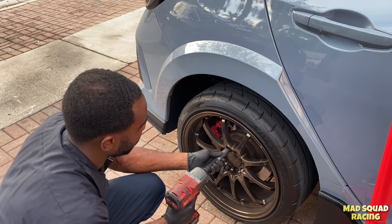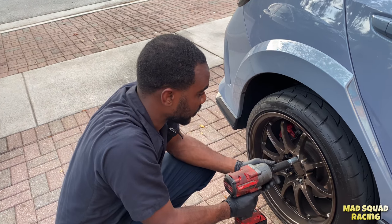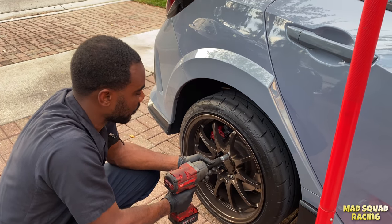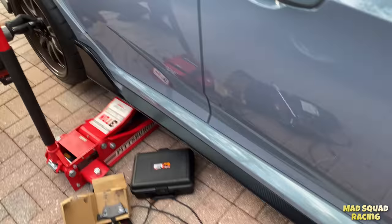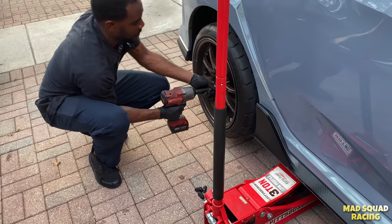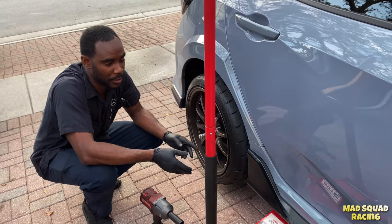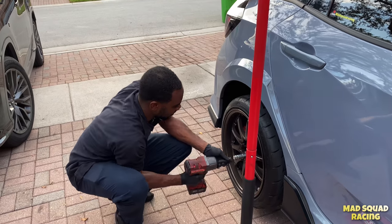You can't just press the piston in with a regular screwdriver because it's different — there's a motor on the back for the emergency brake. Normally there's a special tool required, basically a scanner connected to the OBD port, to tell the car you're going to change the rear brakes. We don't have that tool, so we're improvising.